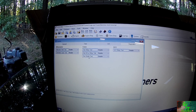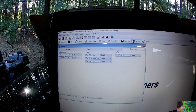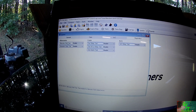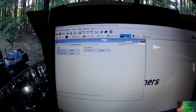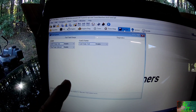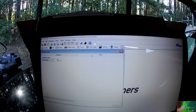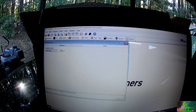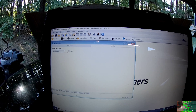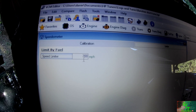For diagnostics, we kept fan relay test disabled, fan high/low relay test disabled, fan clutch test relay disabled, and AC relay test disabled. The only diagnostic item we kept enabled was the alternator field test, so the alternator will register. For fuel, I disabled the EVAP pump and purge, but kept the fuel pump test enabled. I also set the speed limiter — originally 112 mph — up to 200 mph.